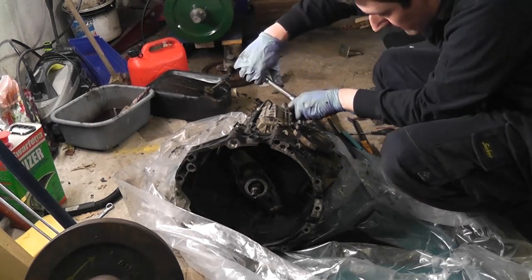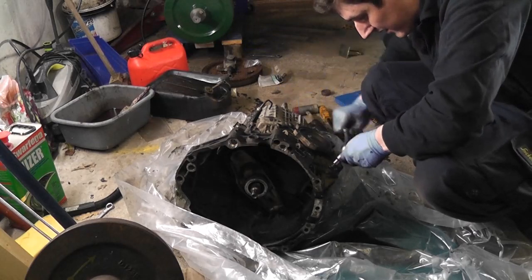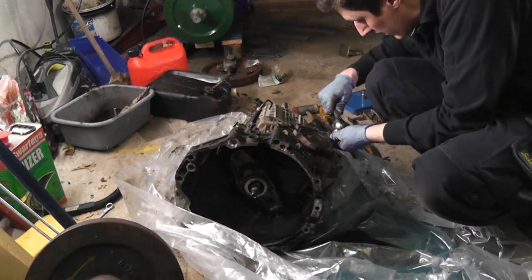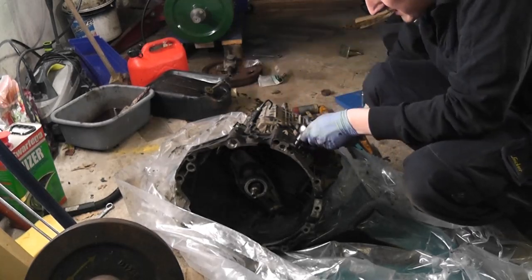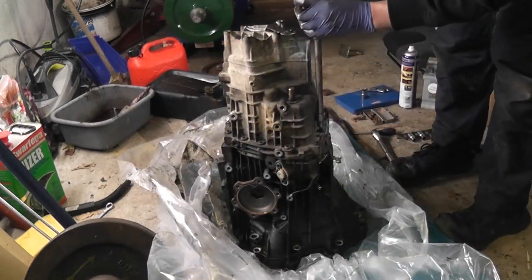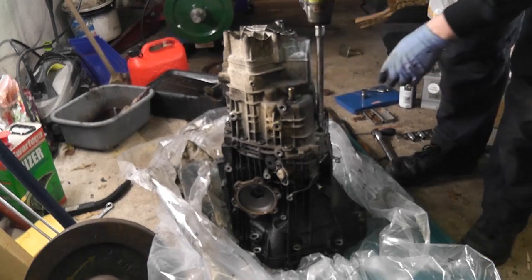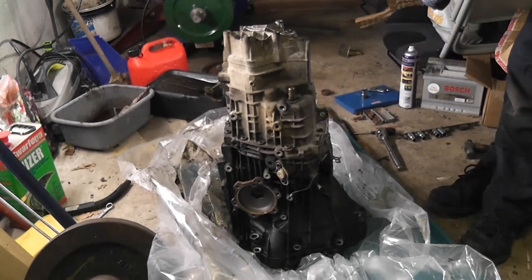So, with time, you develop a feel for these type of things. Yeah, see, I'm going crossways on each thing to pull it down square. Okay, so unfortunately what happens sometimes with an impact gun when you're using an extension is it takes some of the torque away.